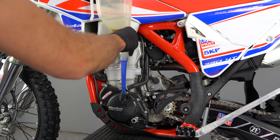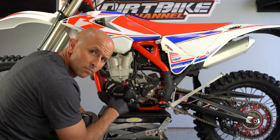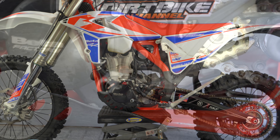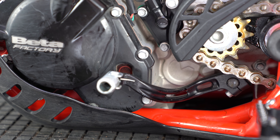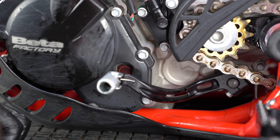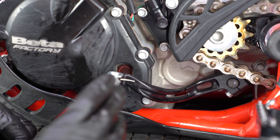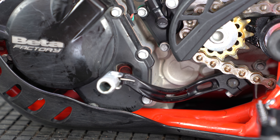I'm going to run it like that for just a minute. We've got our oil now just to the top of the sight window. You want to be up to the top of it, but not overflowed. I ended up needing just a little bit less than the 750 CCs of oil. I'm glad I didn't put it all in — I was about 50 CCs short. Must've still had some in the engine compartment somewhere. Anyway, we're good on that.